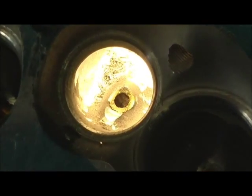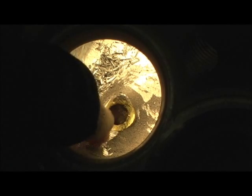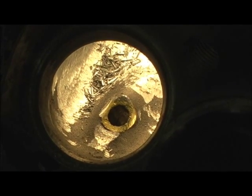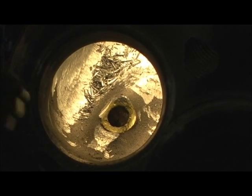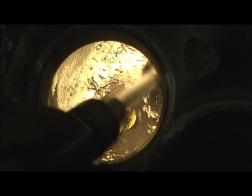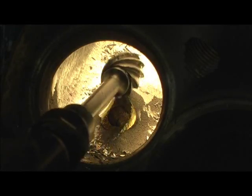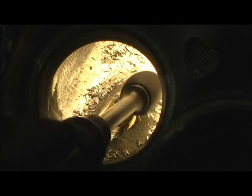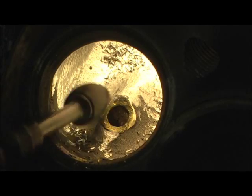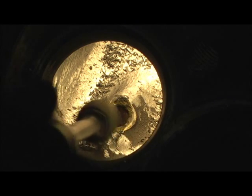Let's try to zoom in there and see what we can get. Alright, now you can see — I came in here and I flattened it, but I tried not to dig too much out right there. So what I want to do now is go with my big burr. I'm gonna start at the very bottom down here and try to roll it. I'm doing that to pull the hump — the boss where the guide is — trying to pull that in so that when the air gets up it won't have such a dramatic turn as it's trying to bank off the guide.